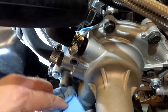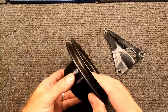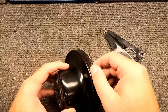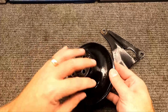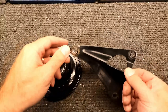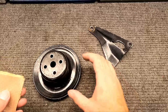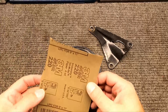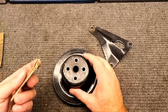Here are the parts I want to refinish. The bracket will be pretty simple — just sand it down and go. For the pulley, I don't want to mess with the belt groove. I could clean it up a little but I don't want to put paint in there, because I want the belt to grip onto metal, not paint. So I'll just scuff up the face and get it prepped for paint. The backside is dirty but you'll never see it. I'll start with 100 grit to knock off the big stuff, follow with 220, then maybe 400 at the end to get everything nice and smooth.